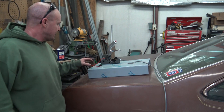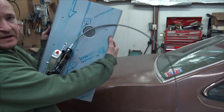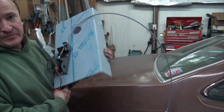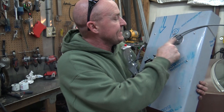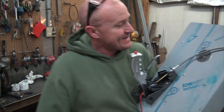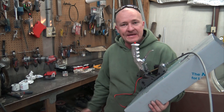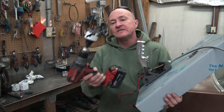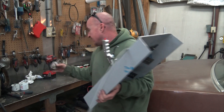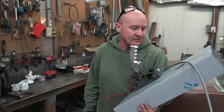So here it is, sitting on the back of the Firebird. What I was going to do was pop a hole in it so I could drop the cable down and run it through and back around the tunnel. Two hole saws later, it just doesn't want to go through the one-eighth inch carbon steel plate. So this Lennox one just decided to spit out all its teeth, and this Milwaukee one just smoked itself. And that was all the hole saws I was wanting to expend on this — so I gave up.